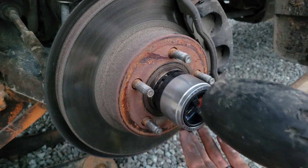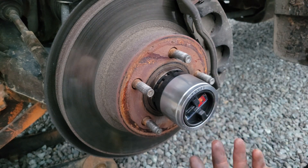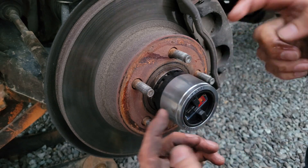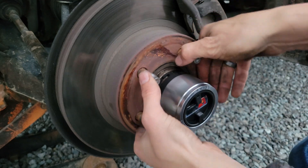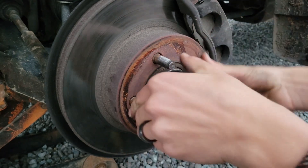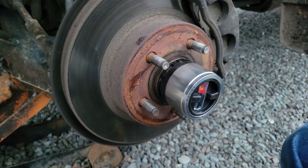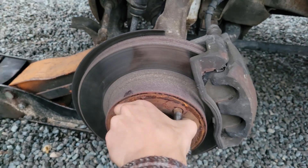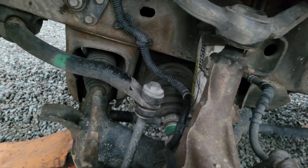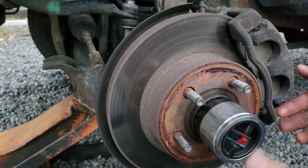Just in case, you can do a little rubber mallet on the metal part. That's basically the whole thing — double check that the plastic pieces are sealed around the ring, and that's it. You can test it: turn it forward in the lock position, and back in here when we turn this it also turns the back, so it's actually locked in and the CV axle is turning.